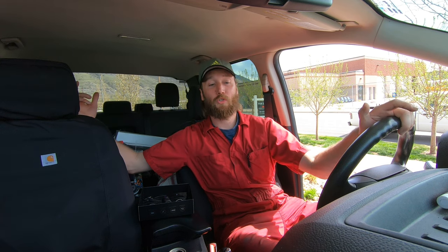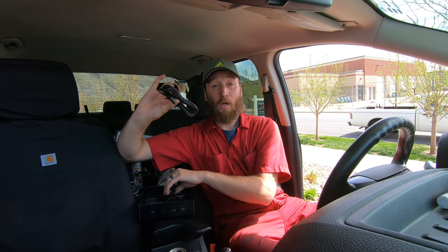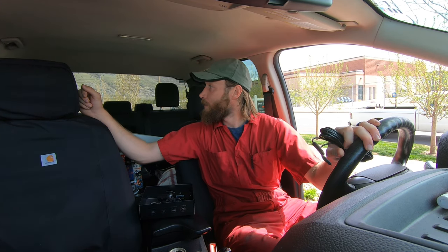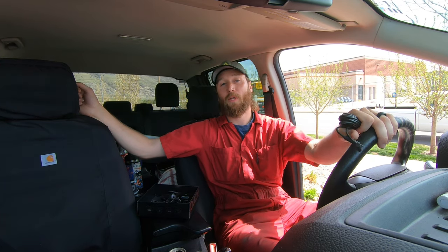This is a newer Ranger that has a lot of sensors up behind the mirror, so we're not going to put it right behind there. Here's the rear camera, which is again adjustable, and we've got the long information cable to run all the way to the front — looks like about 10 feet, good for a pretty decent size SUV. On this Ranger though we're not going to need that much, so I'm probably going to do my classic hideaway in the back pillars. There's usually a lot of space, and usually some airbags, so I'll try to tuck it behind the airbag, not in front. We're going to go ahead and run a normal power cable for now.